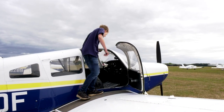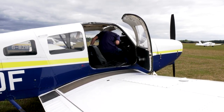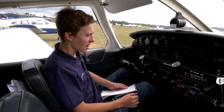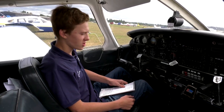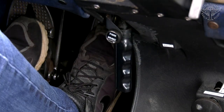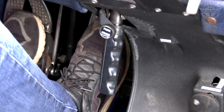Now it's time to walk into the plane. Check that the parking brake is on. If the aircraft has been left overnight, the disc pad hydraulics can lose a bit of pressure. Pull back on the lever, then pull back again and press the button while pulling it back, and it re-engages the parking brake.